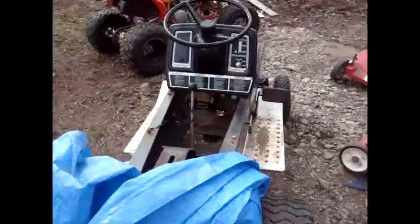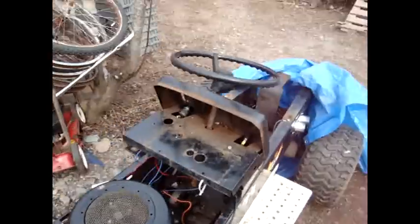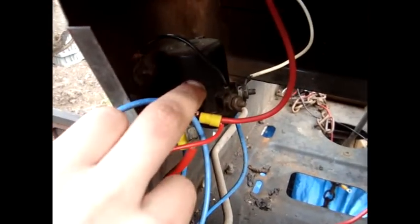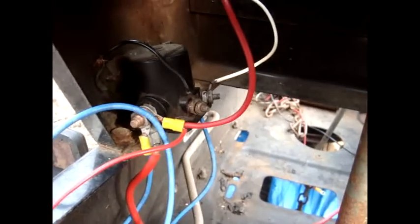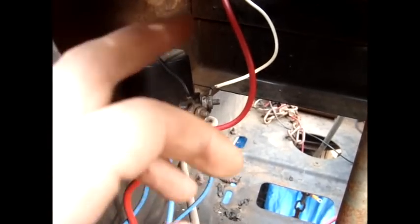Keep watching. This here is the Roper mower that I have push-button ignition hooked up into it, and this is how I did it. Now, every one of these mowers has a solenoid, similar to this. Some are more circular and kind of flat, but they're pretty much all the same. Most of them have a typical ground wire that comes off and goes to ground. There's the white wire which engages the solenoid so that it gives power to your starter.